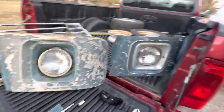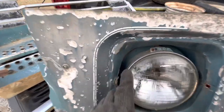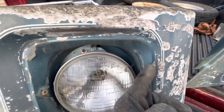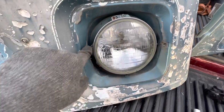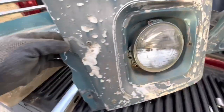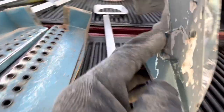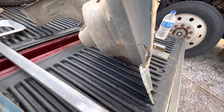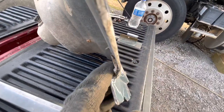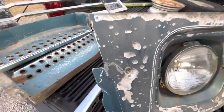Here's my pile of parts. Look at both sides of these — this is what happens if you don't properly prep your surface before you paint it. It just flakes off. In all likelihood this was never sanded or scuffed or anything. And this is a crack — you can see right in here is a layer of mud, this is just Bondo. You can see a little clump of it there. I'll take that all apart and fix it the right way.